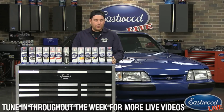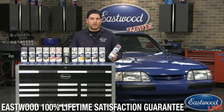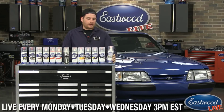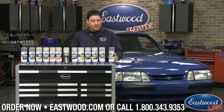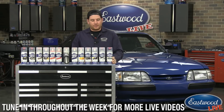So you do have to plan out your project, because this is just like in your paint gun. If you mix it up and you let it activate and it hardens, you get one shot. So you can't put this back in a month or 2 later, pull it back out and expect to use it. Pot life is basically the amount of time that the product is usable after it's been activated. So you can leave this can on the shelf without too much issue. I think it was a year or 2 years we give on this when it's unpunctured. But basically, as long as you haven't punctured the bottom here, you're okay to use it. But as soon as you do that, you need to use it within a fairly short period of time.